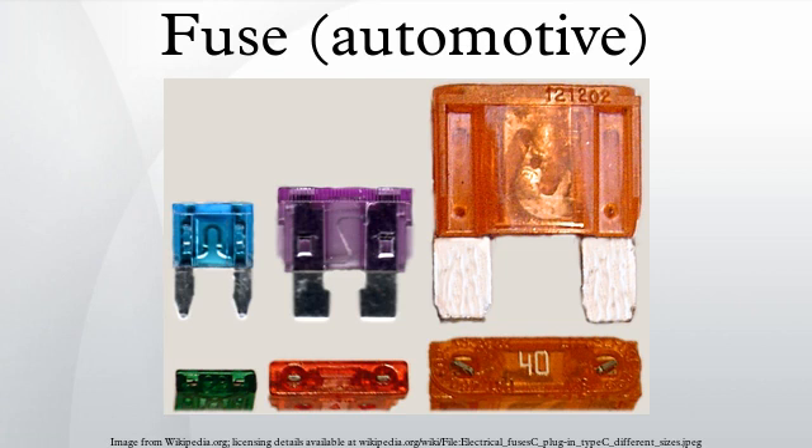This can be a source of confusion when replacing Lucas fuses with non-Lucas fuses. The Lucas 1/4-inch diameter glass tube fuse has a different physical length compared to the standard U.S. item. The Lucas 1/4-inch diameter glass tube fuse is 1 and 5/32 inches (29.4mm) long, while the U.S. standard 1/4-inch glass tube fuse is 1 and 1/4 inches (32.0mm) long.